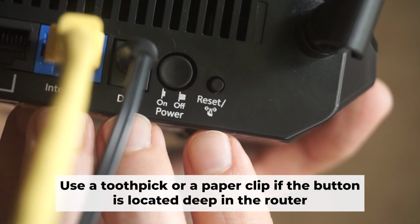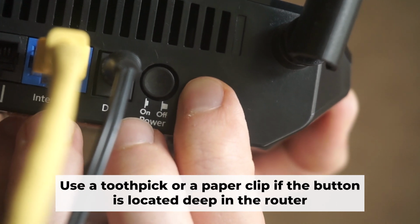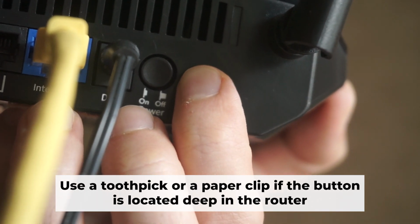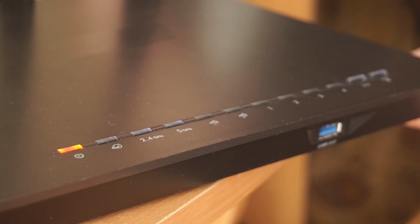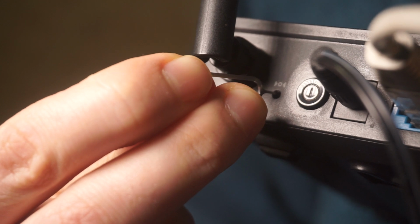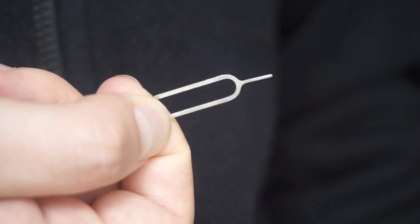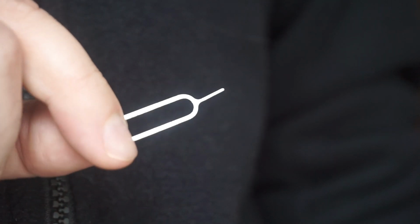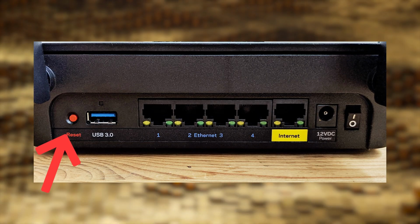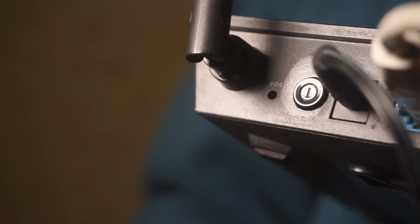You now need to reset the router to its original factory settings. Hold down the reset button on the router for 10 seconds. Wait for the router's indicator lights to start flashing. Occasionally, this button can be found inside the router casing to avoid accidental presses. Use a slender object to push it down. The router will reboot, and all the settings will return to their factory defaults.